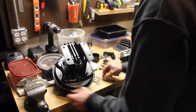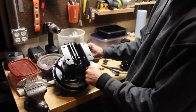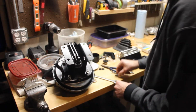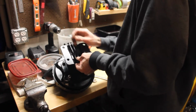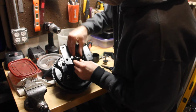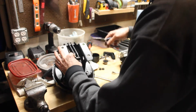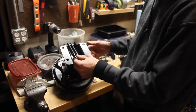And then, once you get these screwed on, I've replaced them with stainless steel washers, lock washers, and nuts. Then you take your pin, take your pivot arm, line it up with your piston coming out of your brake booster, and just slide it in through this hole. And then from there, you can put your cotter pin through, and that will at least hold it in place while you do everything else. There. We are now installed.